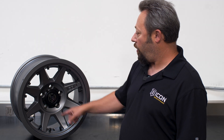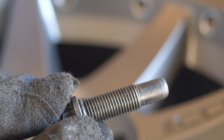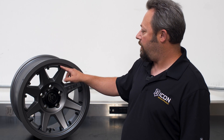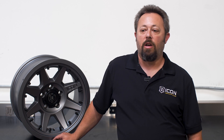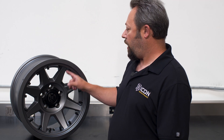Although there are more points of entry through the wheel, the type of seal we use here is an O-ring boss type seal to an SAE standard sealing profile. Because of that, it's a very secure connection, especially when you compare it to your valve stem. Your valve stem is far more prone to damage and deterioration over time from the elements. So yes, there are more points of entry, but your valve stem is still your biggest point of concern.